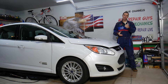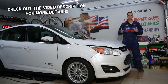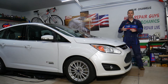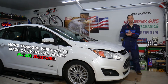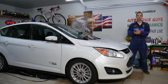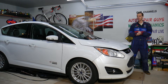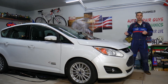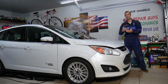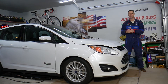Welcome back to World Mechanics. Today's video will be super helpful to anyone with a Ford vehicle — it could be a Focus, Fiesta, Fusion, C-MAX, Escape, Explorer, Edge, or F-150. If you have an electric vacuum pump, which many new engines do, we'll explain how to test it and find out if it's working. If the pump doesn't work, you may have multiple codes, and especially on hybrid vehicles you'll get a hard brake pedal — because when the engine isn't running there's no vacuum, the brake booster won't work correctly, and you'll lose braking ability.